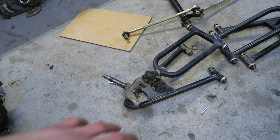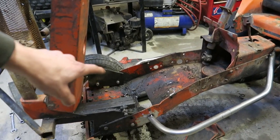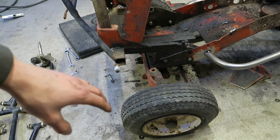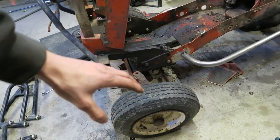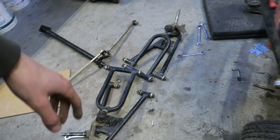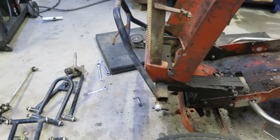I ended up cutting a lot of the frame out here because I'm going to be moving the motor over, taking all the front axle end off, and actually moving the center line of the front axle forward so I can gain a little bit of wheelbase on this build. I cut off the side steering — now it's underneath — so I'll be going over that.